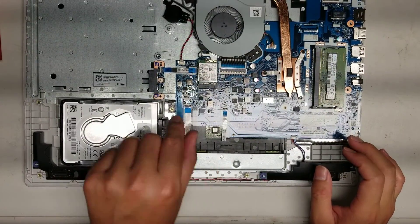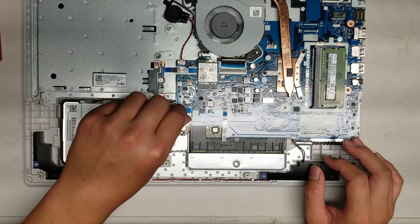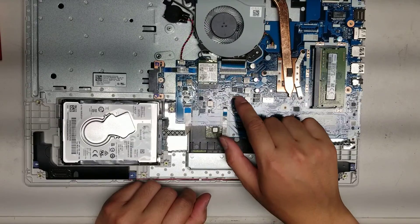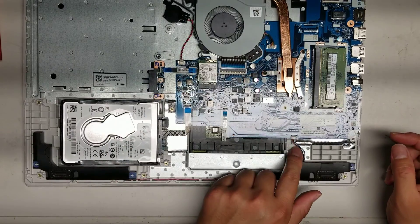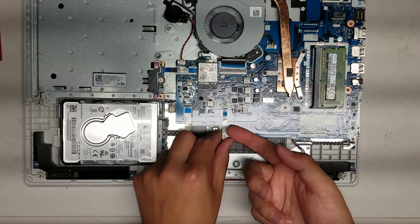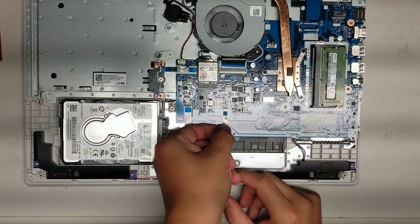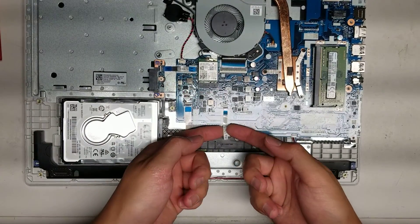You can see the hard drive connector. If you wanted to disconnect it, just flip this little black tab up and then you can pull the cable out. To put it back, just make sure the black latches up and then put it back. Same thing with this one — flip the little latch up and you can pull this out. There's adhesive actually holding these in place, so I don't want to take those out unless I need to. When you do remove them, try and peel up the adhesive carefully. Try not to flex it too much — peel it straight back. You don't want to flex the cable upwards.